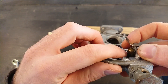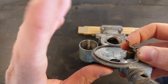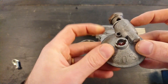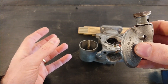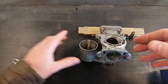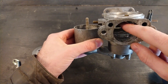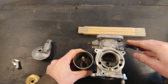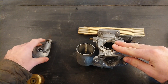If this little valve — the needle and seat — is faulty or you get dirt in there, then your float chamber will overflow. It will flow out through the top or through an overflow hose on some carburetors, going straight onto the ground. Or if that doesn't happen, you'll just overfuel the engine and possibly stall it. This is a common issue on all carburetors, not only SUs.